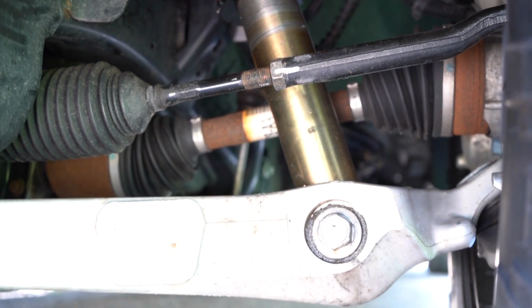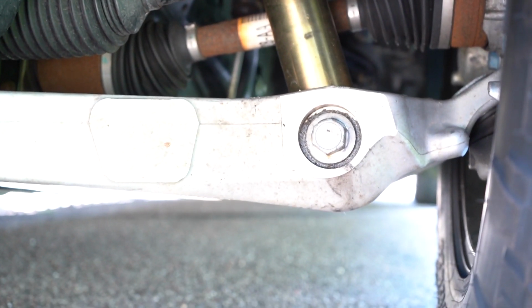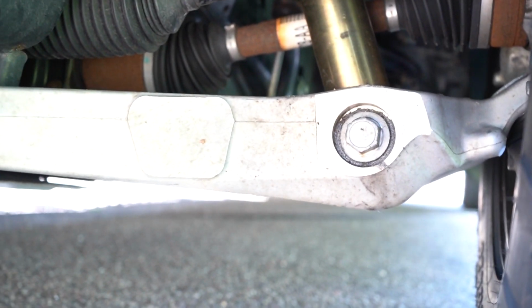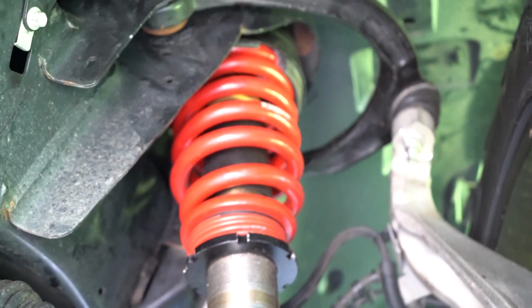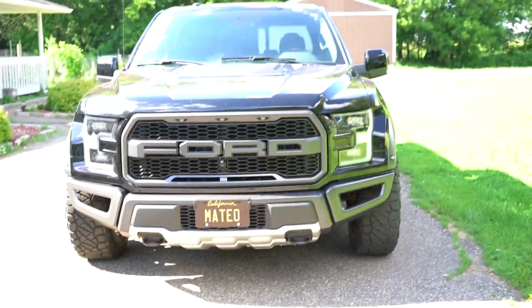So yeah, this strut, that bushing that Dave's talking about is right there, the very bottom bushing where that big bolt goes through. That's what they had to change, as well as they had to do a bunch of stuff for the alignment. And then up there, they had to use leveling kit hockey pucks, you know, in there to be able to get this to go.